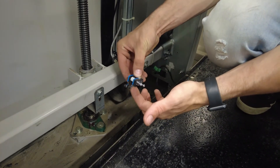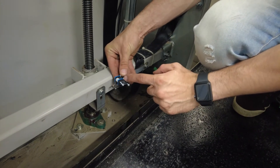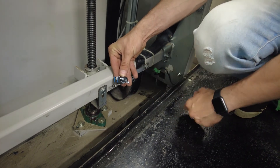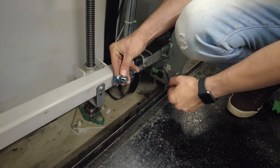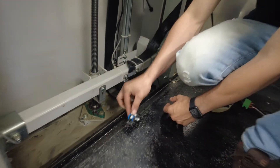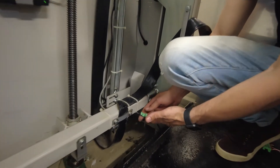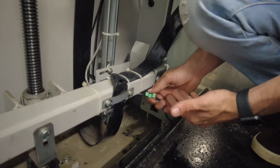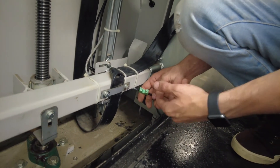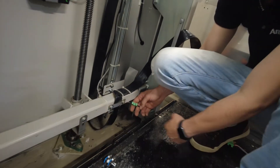The two switches should not be activated — you should be able to click them, and they should be plugged into the top and bottom pins. We do not use the middle pin. The two wires that plug into it are the ones that are not painted. Those wires follow out through a quick connector — the same type as we had for our extreme limit switch — but you can't mix them up because the connectors are female and male inverted, so you can't mix up the underpan with the extreme limit switch.